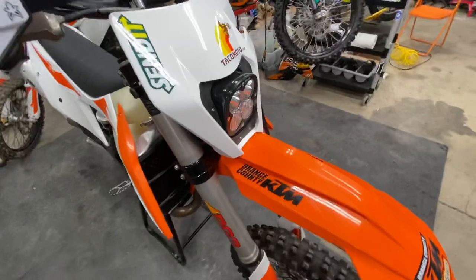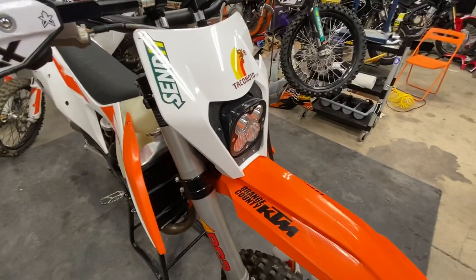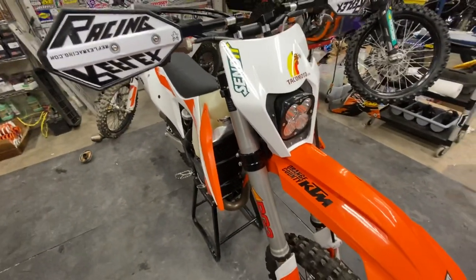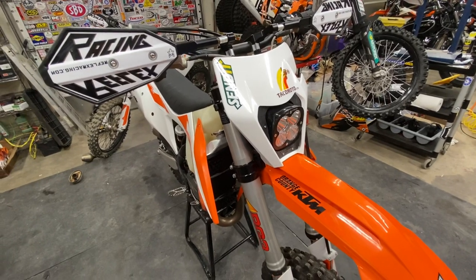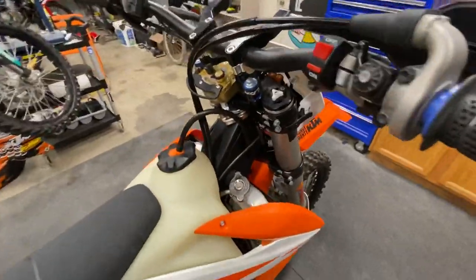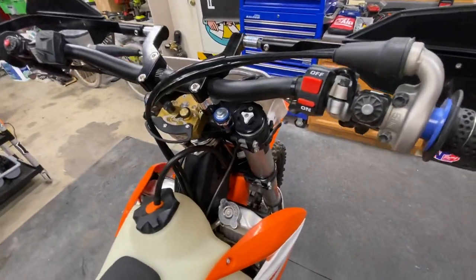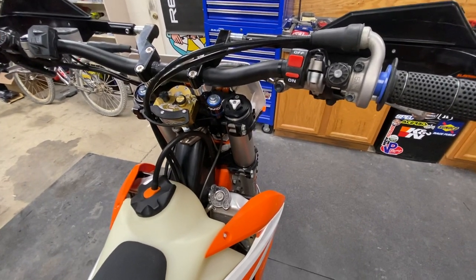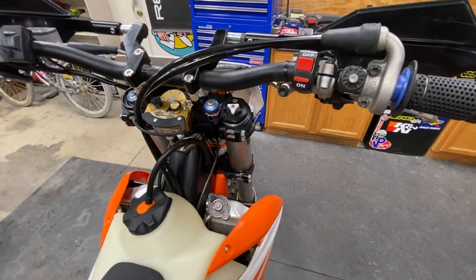We've got a lighting kit up front — the Moto-Minded XL Pro. We can't push any more than that light off the stock stator. We could do an XL80 which is 80 watts, but we would need to replace or upwind the stock stator, which we didn't want to do. So the XL Pro is the max we can push with that stator. We have this wired up with an auxiliary power interrupt relay system so that when the engine is on, that switch goes hot. That way we're not draining the battery when the bike is sitting in a garage or trailer and somebody accidentally clicks it on.